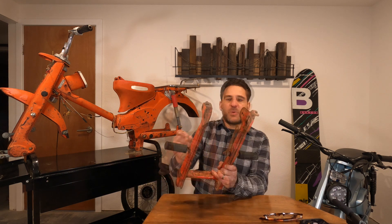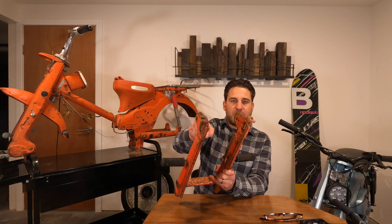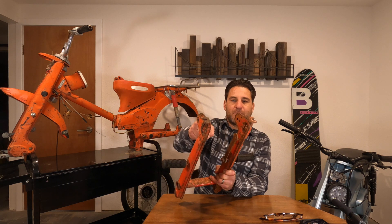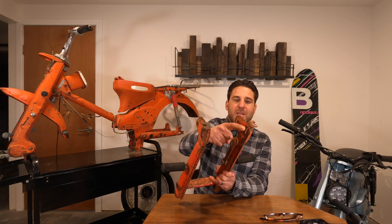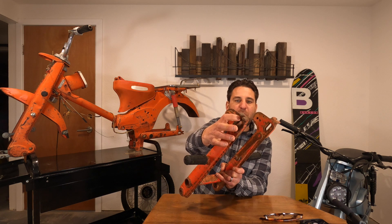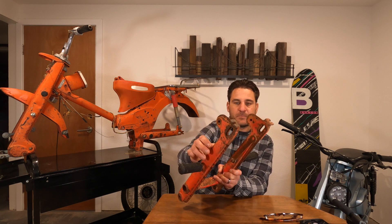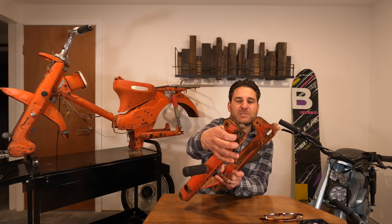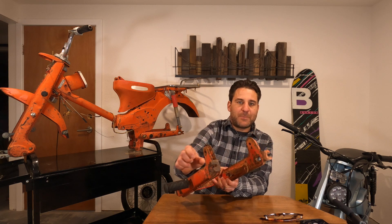So the hub motor and the swing arm. The swing arm I use is 170 millimeters, occasionally 165 if it's bent. Most vintage Hondas are 170. The motor is 150, which gives you 20 millimeters. This allows space for the caliper adapter and a spacer to center the rear wheel. You will have to cut both of these backs off so the rear wheel will slide in. Remember you'll have some vertical slop here.